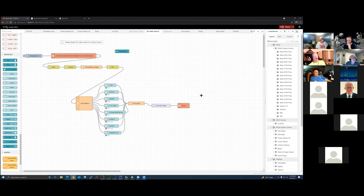You can have it set up as a watchdog: if for whatever reason you can't ping MSN and Google, or whatever site or combination of sites you want, after whatever number of tries and whatever time period you set, it will automatically reboot these two outlets. Then it goes another 15 minutes trying to ping them, and if it fails, it reboots them again. It just turns the outlets off and on. It's a pretty cool little feature.